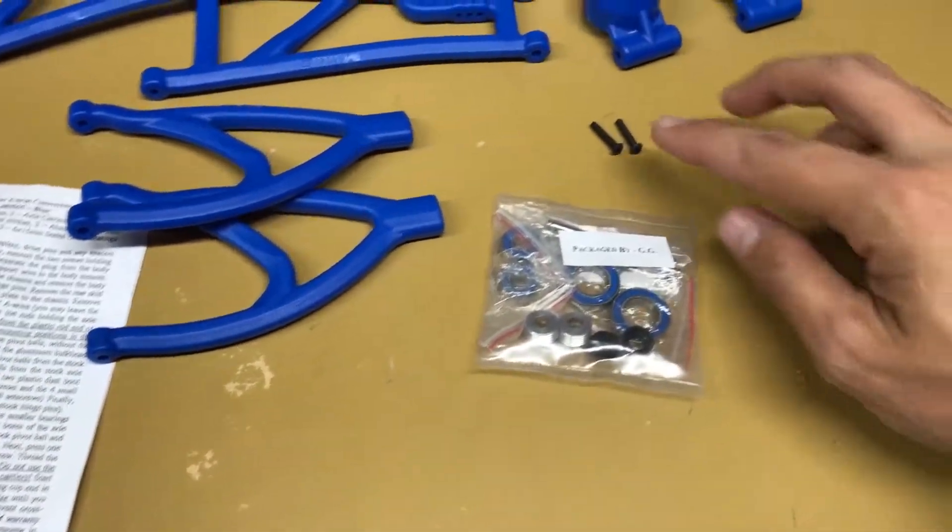You can see I've got the suspension arm with the ball joint screwed in. You're going to get a plastic washer that they've provided, so that goes on top — make sure it's nice and straight — and then you throw in the aluminum piece to seal all of that together. I've got one side done and you can see it no longer has that toe link piece because of the way it's set up.